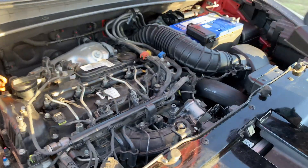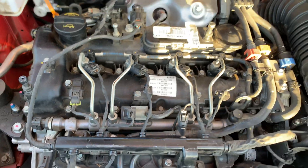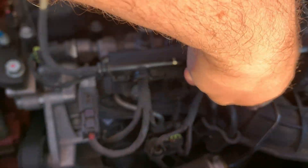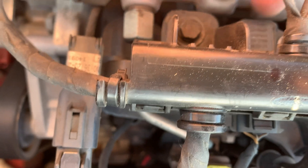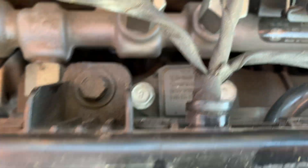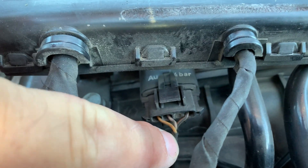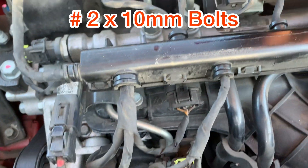Let's pull off the engine cover and take a look at this motor. This one is actually the 2.0 litre version of the common rail diesel. The culprit we're looking at today is right here on this front manifold — this sensor right here. You can see those two little — I think they're 10mm bolts. And on the front here is the electrical connector. That's the part we're going to swap out. It's just two bolts holding on the sensor and I think there's four bolts holding on this top rail.